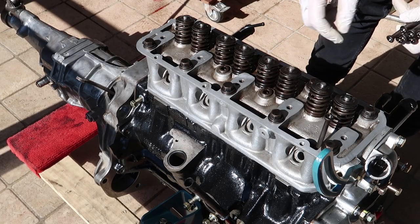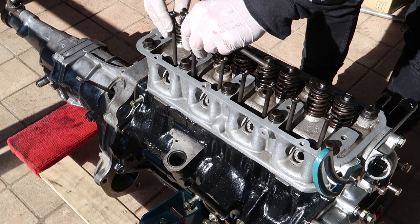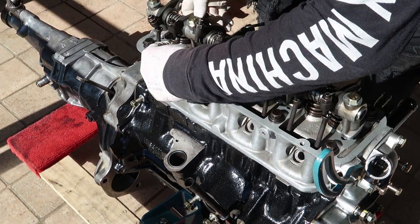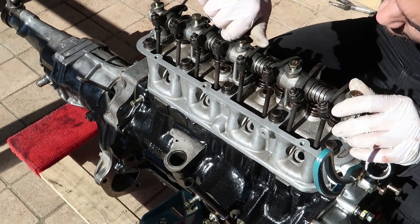After torquing down the head bolts in three stages following the correct sequence, I'm gonna do the valve clearances and then seal everything up. This is especially important as I've lapped the valves, making them sit a little lower in their seats. If you'd like to see the detailed procedure, let me know in the comments below and I can possibly whip up a quick one for the channel.